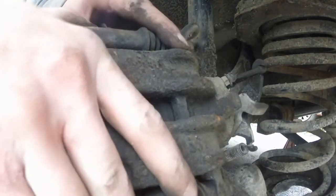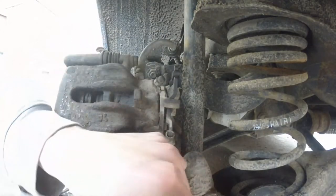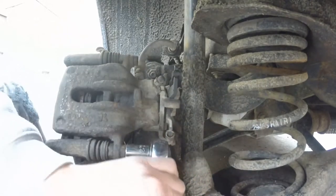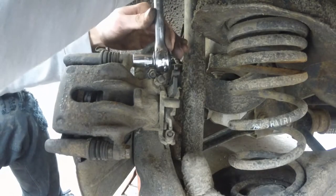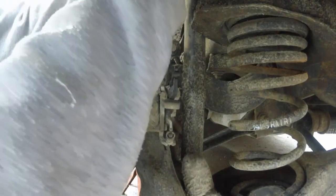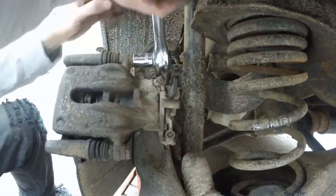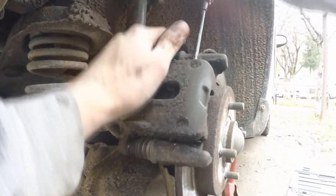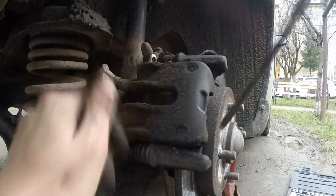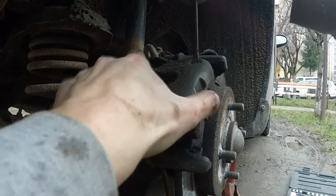The caliper was stuck because the rotor had grooves, so I had to use one or two screwdrivers to pry it off. I was thinking if I loosen those two bolts the pads would fall out of the caliper so I could remove them — those two bolts need wrenches on the other side to hold them. The exterior bolts were 13s and the interior ones 11 or so, but your best bet is to take a whole wrench and socket set with you.